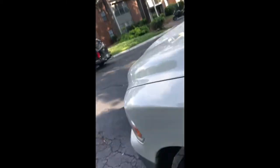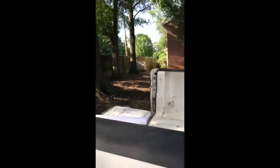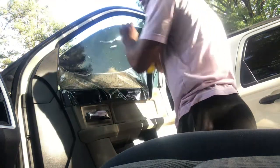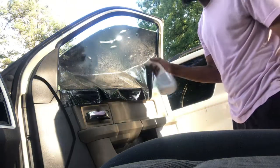This is my tint install — five front, five back. Not too dark, you can still see a silhouette through there. I'm going to the other side where it's still stock at 35 and zero. It's hard to get good angles on it but it makes a whole lot of difference. Now I'm going to get started on this side — these front two and possibly the back today. I got everything recut and re-lined up from the outside. Now I'm about to squeeze it down from the inside and roll the window up to apply it under the weather stripping. Always good to wet the window too so your squeegee can slide across easier without tearing the tint.